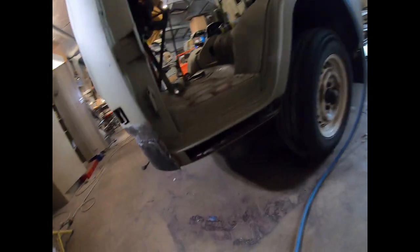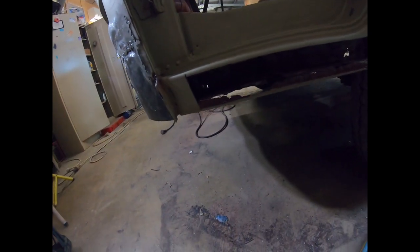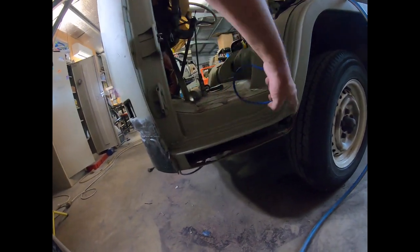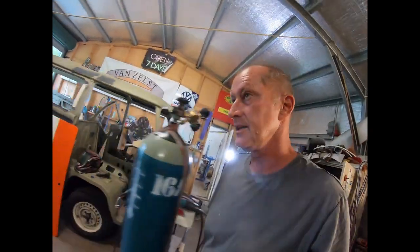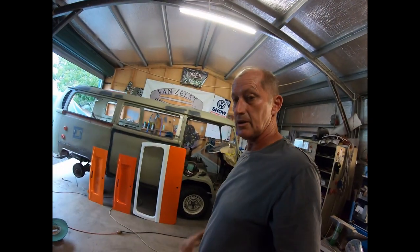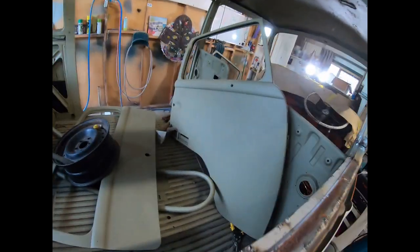So it's really coming along. I think I've recapped everything. We're waiting for an inner step there because it's too far gone to be patched — it's not worth it. So we're getting an inner put in there, and then an outer skin can go on there. We've got another patch to put in there, and the headlight bucket's got to be repaired. Lots happening, but Chile — you would definitely say that the bulk of the repairs are over and now there's just some smaller stuff. Andrew's been going hard at it.